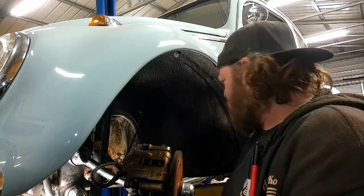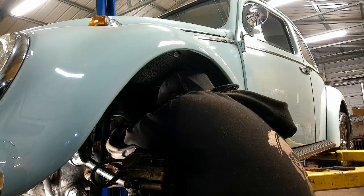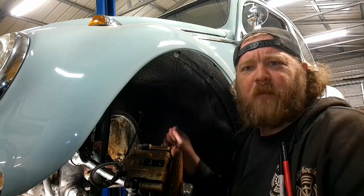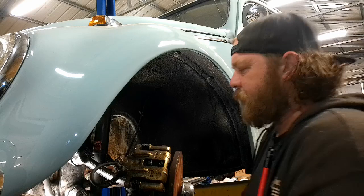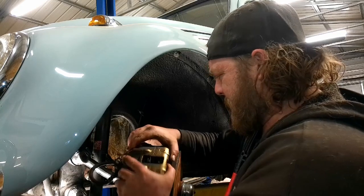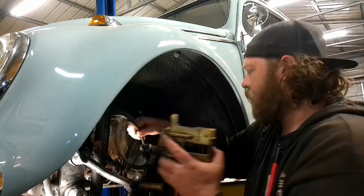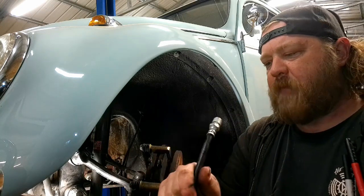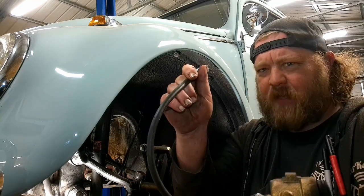All right. That's off. And we'll take our little plug and boop it on. All right, so I'll minimize the leakage, and now I got stuff on my hands. But, all right, pull this off. There we go. One brake caliper off. I'm not even gonna compress the piston any more than that because I wanna eliminate bleeding and ease installing the other side, because this thing's still semi-loaded.